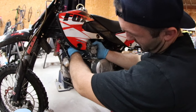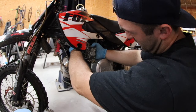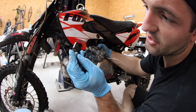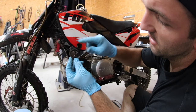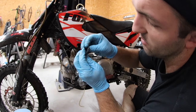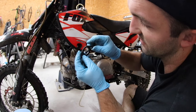So when you go to pull the carburetor off, after you got both nuts and bolts taken off or loose, you just pull the gasket off, and be careful with this gasket because it's all plastic, but it has a rubber center section. You can see this one's actually cracked off. This could be why it's running so bad. It's complete here, but it's missing this portion. So it might still be sealing, but if it's getting air in right there, it's gonna run a lot worse. So we might try to put some gasket RTV on this just to see if that's the problem.